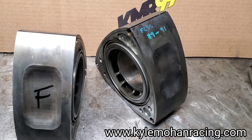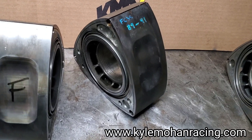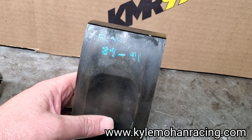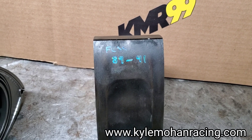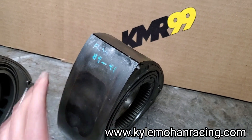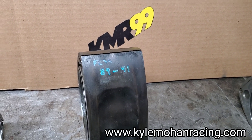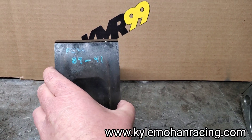We're going to start off and go down a little bit of that specification and information. This particular RX-7 rotor, the '89 to '91 in the U.S. — although in some countries they were available into the '92 year — is available in a high compression and turbo low compression application. From the factory, they came in at approximately 9.5 pounds.